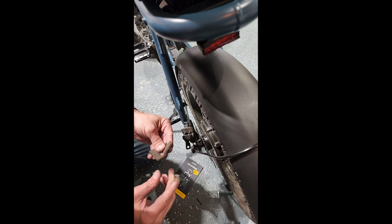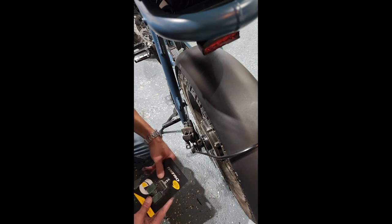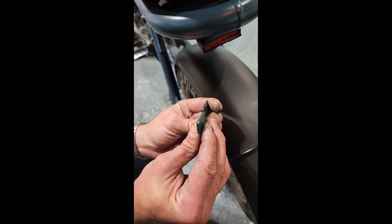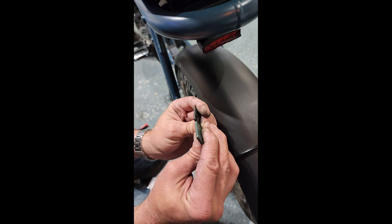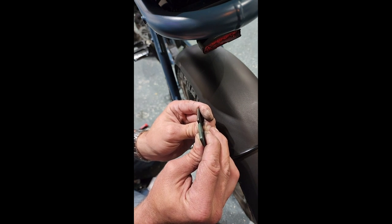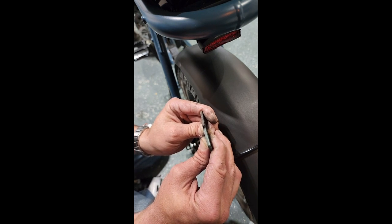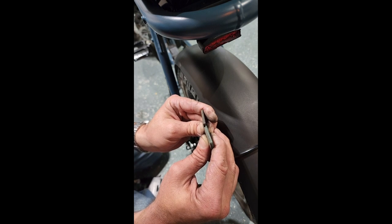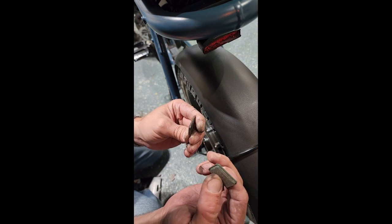On some vehicles you can actually pull the pads up through the top — there's a much bigger opening. So these brake pads actually still have some wear on them. I'll open up this new pack so you can see the difference between the wear on these and what's on the new ones. This guy has barely even used his brakes. He's got about 600 miles so he probably has a pretty easy riding style. Riding styles differ from person to person — some people really like to accelerate hard and brake hard, so your brake pads are going to wear a lot faster.